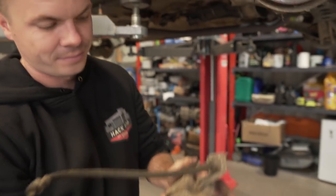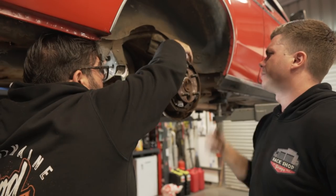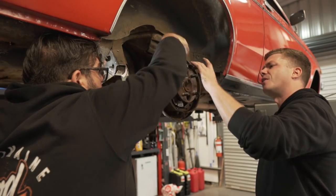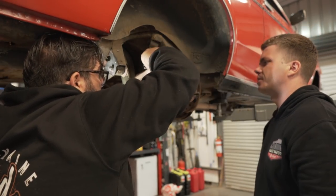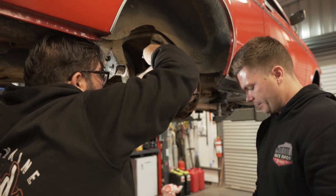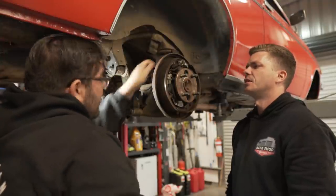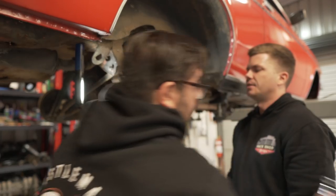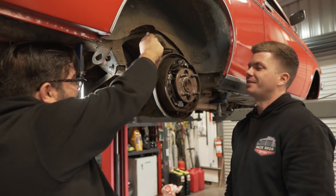It probably will. So what we're replacing now is the wheel cylinder for the rear brakes. They're pretty corroded, and it looks like there's witness marks of all the brake fluid leaking around it. So we'll replace them. They're easy and not expensive. At least once they're done, they're done. I've done this on my HQ a couple of times because they don't like sitting around.